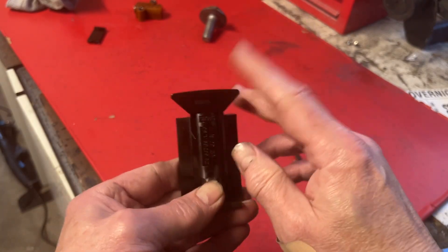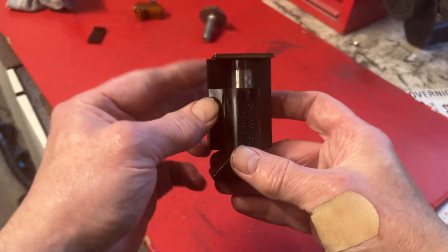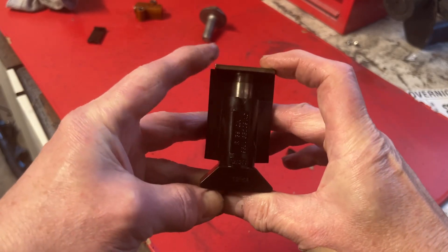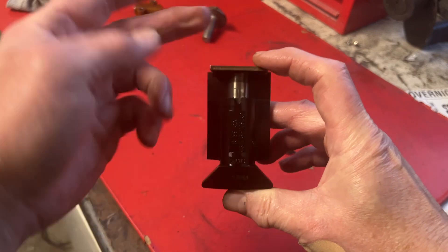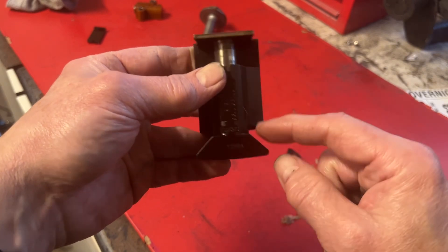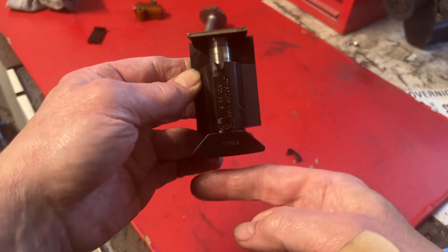Obviously on the other side, the left hand side, the tensioner is upside down. This is not a left hand tensioner but it sits like that, so the top where you've got no problem with tension is actually the slack end — the piston end of the tensioner. The actual bottom is where you probably have some slack; as I say it's upside down like this.